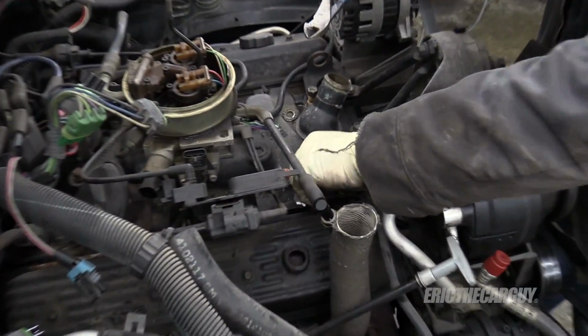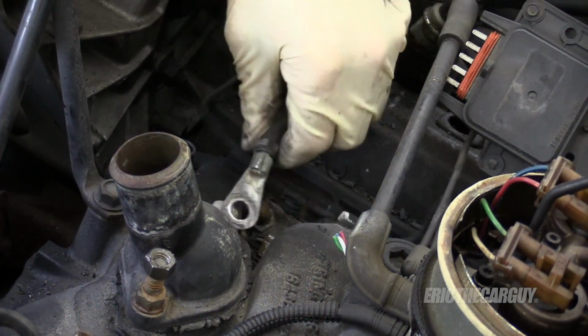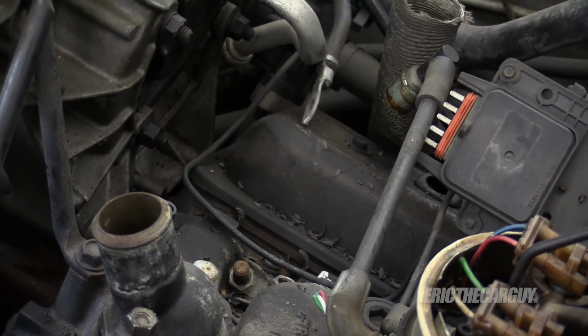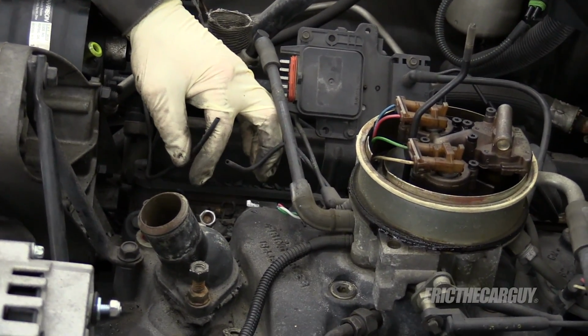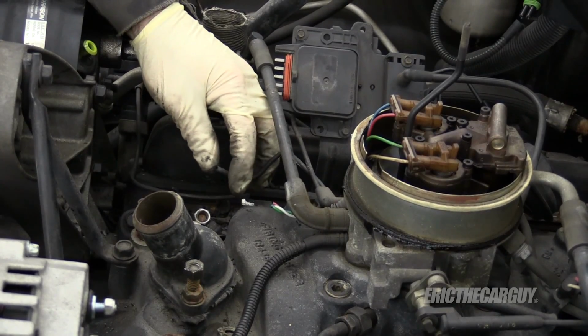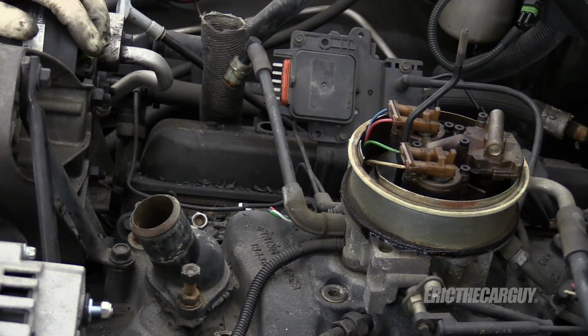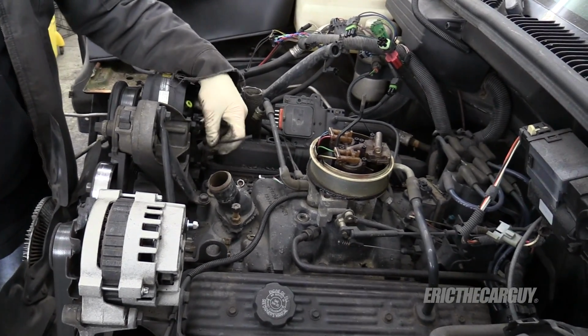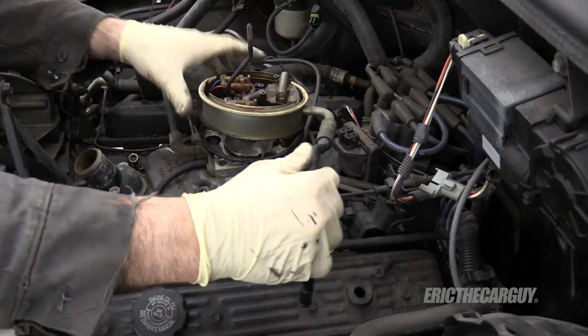Here's a giant ground connection, like the biggest one of them all. See, like they all kind of did this. So the fix was just to take a piece of vacuum line, slide it over this, boom, you're done. But yeah, weird vacuum leaks because of the stupid plastic crap that they went to. Cheaper than rubber. This isn't needed.